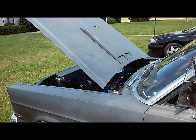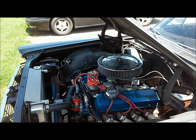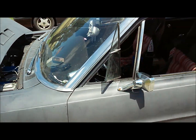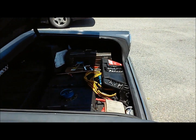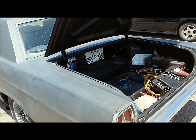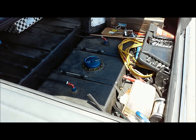Since I put this system on, it circulates the fuel and keeps it nice and cool. I don't have any of those problems with fuel boiling and leaning out and bad running in traffic. I've got a big aluminum radiator so at least I don't have overheating issues. I'd recommend with these electric pumps that you have a return line — it quieted my big Holley blue pump way down and got really quiet when I made that swap.